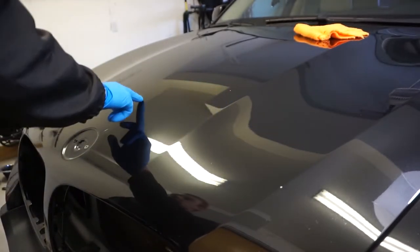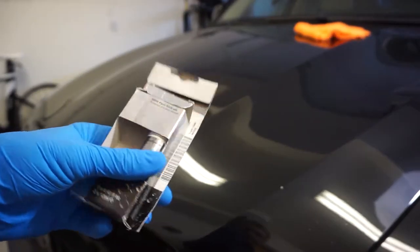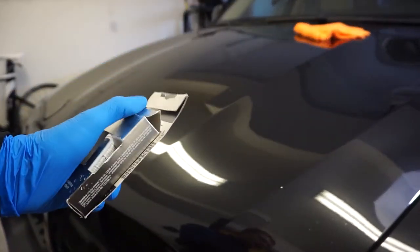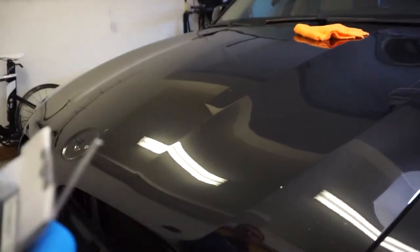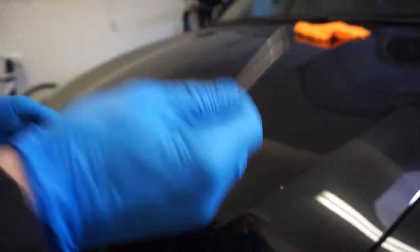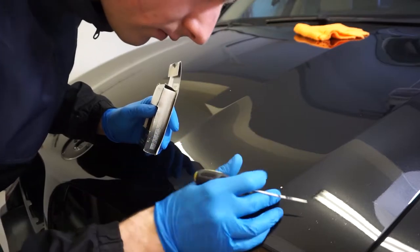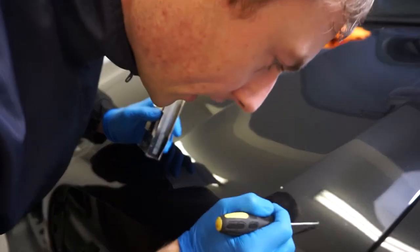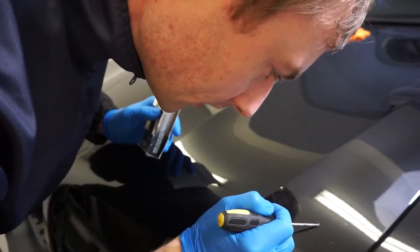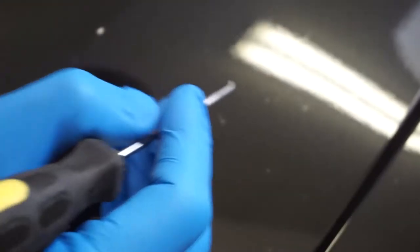There are a bunch of small spots in there. I already picked up the original paint — I actually had it with the car. I'm not going to be using the original brush that came with the paint; I'm going to be using the pin tool, which is ideal for really small spots like this. For smaller chips, I'm not going to be too worried about those.